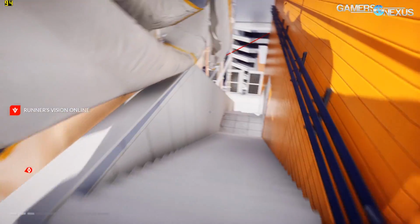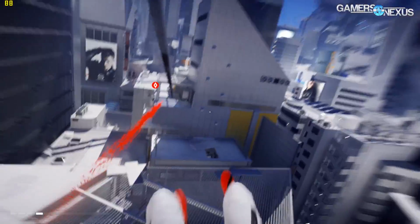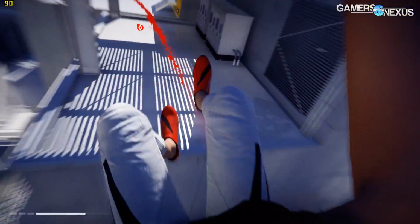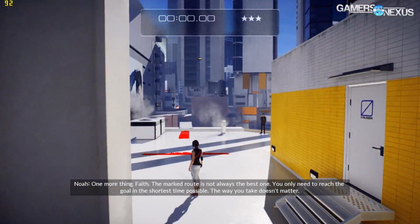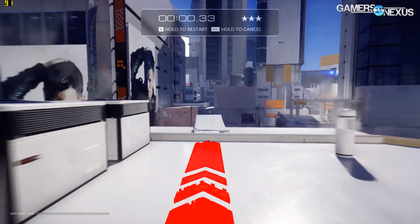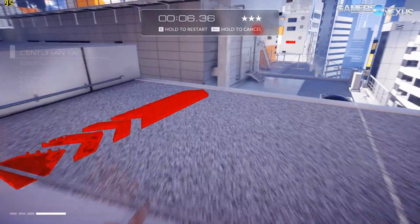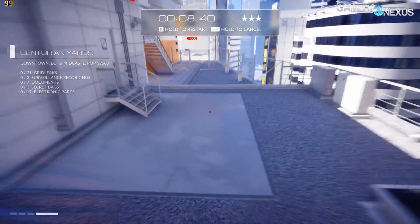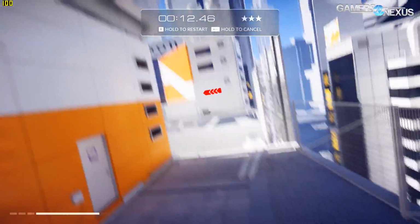We ran the SLI configuration at the reference clock for these tests, giving us a clock versus clock comparison for a single 1070 versus 2. And we also tested the 1080 at its Founders Edition clocks in all of the tests. The only instance where we tested the pre-OC'd MSI 1070 standalone, meaning one of them at the pre-OC value, was in Mirror's Edge Catalyst because it's brand new and we're transitioning to the AIB partner cards for our benchmarks.